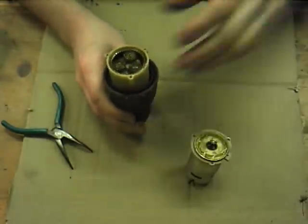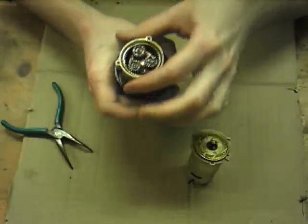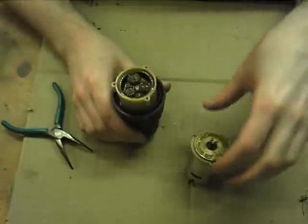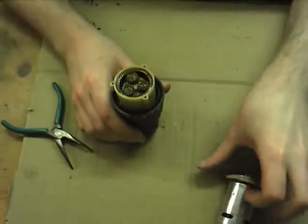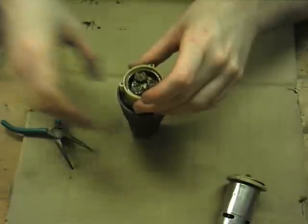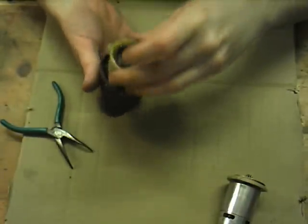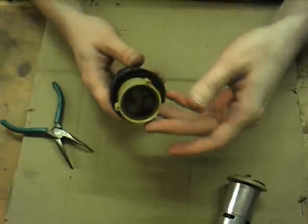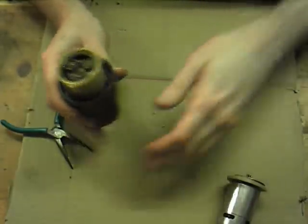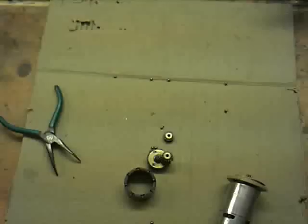So using that spring and ball bearing mechanism just allows you to adjust how much force it is until the annular gear starts slipping, and it's just to save the motor and the gears, really. You put too much force onto it, stall the thing, it'll start making that horrible tack noise, and yeah, it's a very simple system. And obviously if you're using it for, I don't know, driving something, like wheels or anything where it might be prone to getting just jammed up.